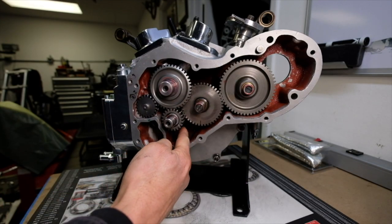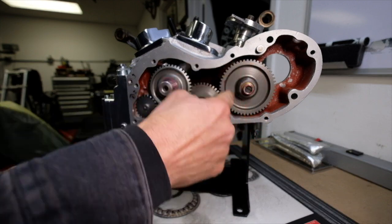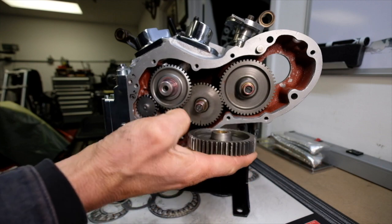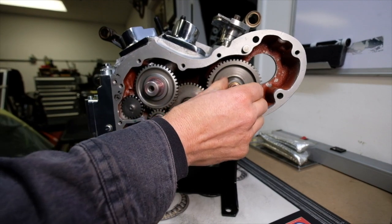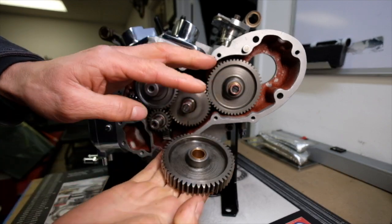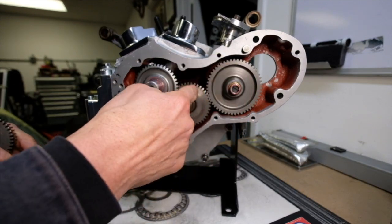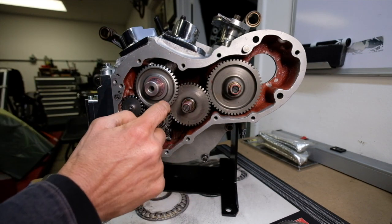This week a bunch of parts rolled in. I replaced several gears - the oil pump drive gears from S&S are in; this is a 624 setup which speeds up the oil pump a little bit. The generator drive gear is brand new - the old one was in pretty bad shape with nicks in the teeth. It's an expensive gear at about 150 bucks, but I wanted the peace of mind of new parts. The new one is full-width and takes up the entire axle, versus the old one which used a big spacer, so I'll be checking the spacing there.